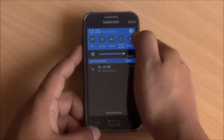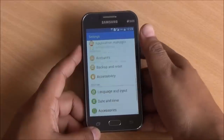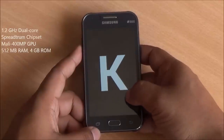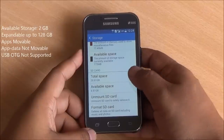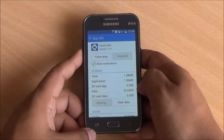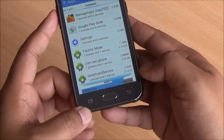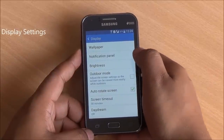This phone runs Android 4.4.4 KitKat out of the box, powered by the Spreadtrum 1.2 GHz dual-core processor with just 512 MB RAM and 4 GB ROM. Out of that 4 GB ROM, about 2 GB is available to install apps and games. App data is not movable but you can move apps to external storage, so gameplay would be limited. USB OTG is not supported. With just 78 MB RAM free, even though RAM management and garbage collection are decent, there is just not enough RAM to multitask on this device.